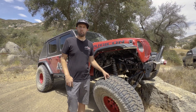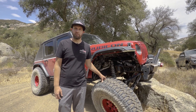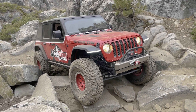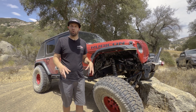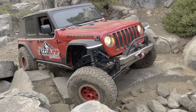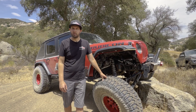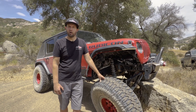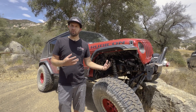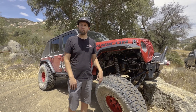Last summer I drove the Jeep up to Fordyce and went four-wheeling for four days. I packed a few hundred pounds of gear in the Jeep and it was sitting a lot lower from all the weight, so I turned up all the DSC just a little on the street to get more control and prevent bottoming out on the drive to the trail. When I got to the trail I stiffened them up even a bit more because the tires were aired down and we were bouncing through the trail hitting some harder obstacles — it was bottoming out a little here and there, so we turned the DSCs up to prevent it. That's a couple of scenarios where your DSCs can help you make the fine-tuning you need so you're not bottoming out when you're off-roading.